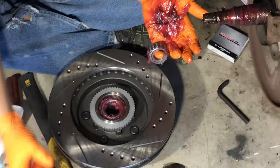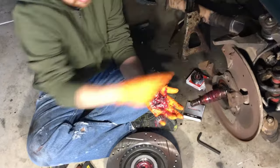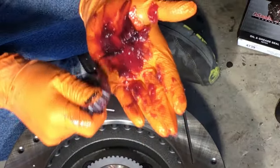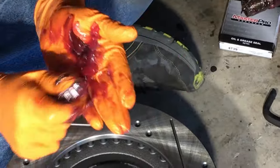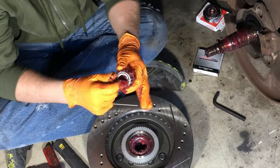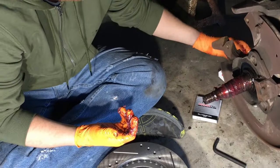This is the inner bearing — you'll be replacing the old bearing that was in the vehicle, if you want to. I figured since I was going through all this, I would redo it. The washer sometimes is stuck to the other bearing, so you want to keep it with the nut. Do the same thing with your inner bearing as you did with your outer bearing — just scoop up the grease until it starts coming out the other side. Get grease on the outside of it too.